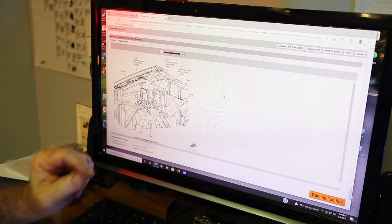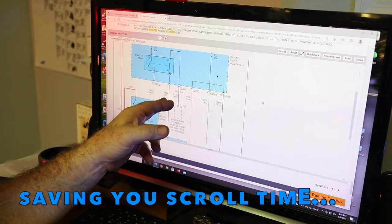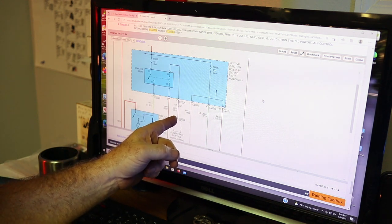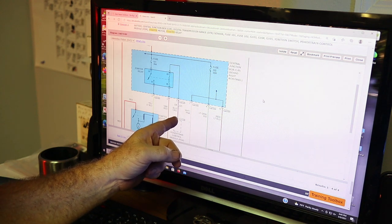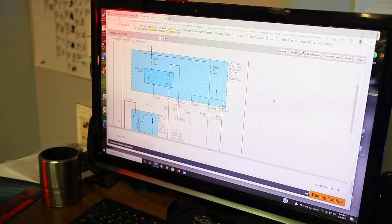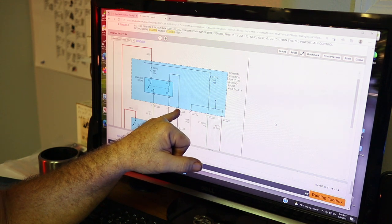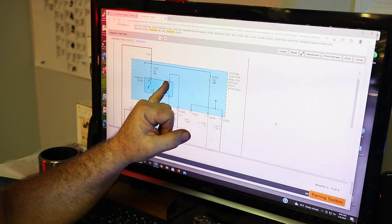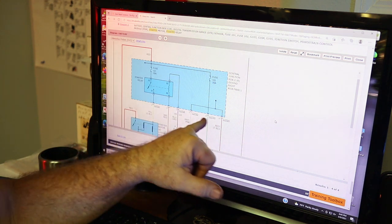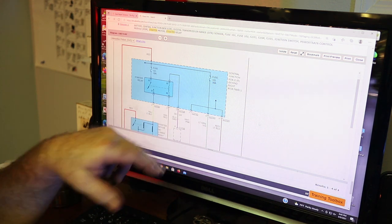Going back to the starter circuit: I have good ground going into the fuse panel at C270A, pin 1. I probably could have saved some time — I went to the PCM because I assumed it had a bad PCM, but I've done more fuse panels in Fords than PCMs. I cost myself some time thinking I was a hotshot. If I'd just gone right to the fuse panel connector, I could have done everything from there — I didn't even have to open the hood. I could have checked for power at the starter when cranking, saw there was no power, then gone to the fuse panel.